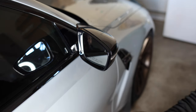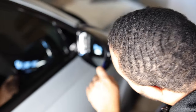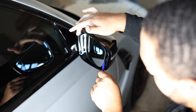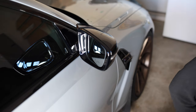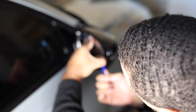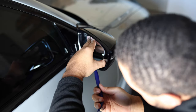Now we're focusing on the side mirrors. You need to push up on the innermost corner to get some area underneath to grab it. Use a small trim tool to get underneath — push towards the car. It's going to feel weird, like you're about to break the glass, so do it carefully and gently. I'm going to use a bigger trim tool to get a little more torque. Just hold the glass with your hand and push towards the car to get these clips loose — it just feels weird because it feels like you're about to smash the glass, but you're not.